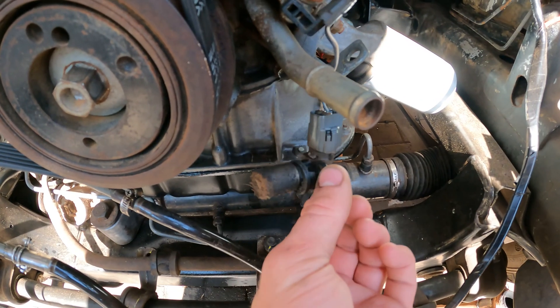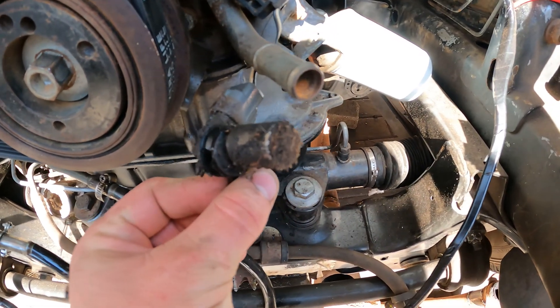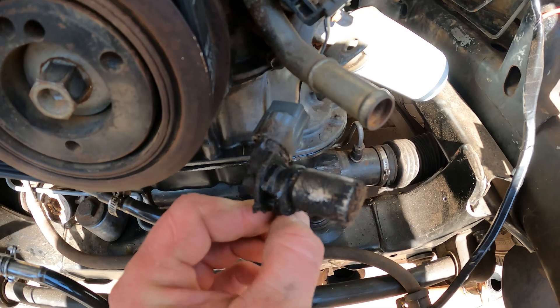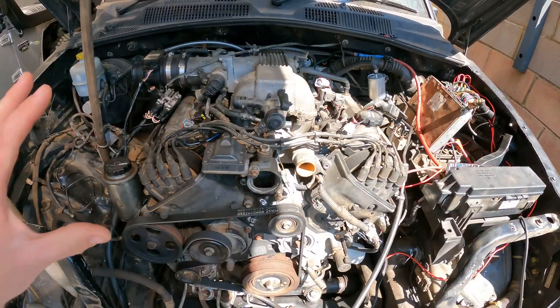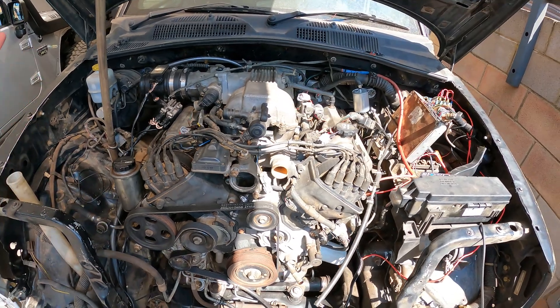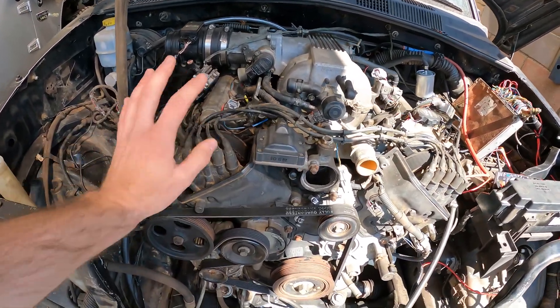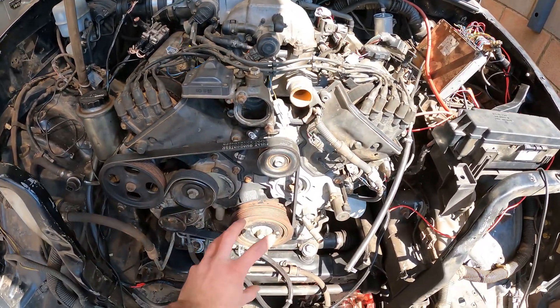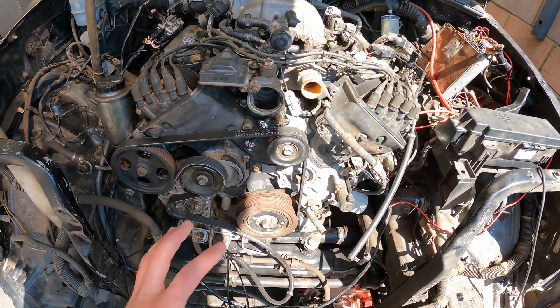Here's a clip of what's going on — I took it on my iPhone. I've got no idea how this engine even ran with this dirty crank sensor. I mean, it's just full of gunk. As you guys can see, that's pretty bad. So I suspect that this whole front of this engine might be gunked up because it was sitting on the farm for five or six years.